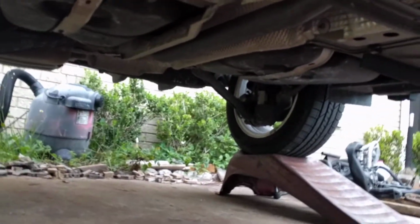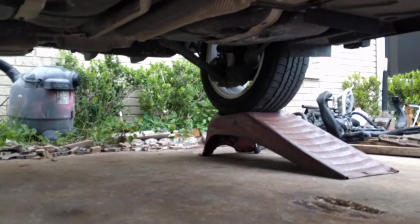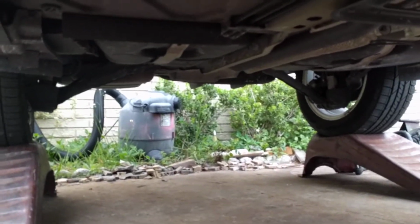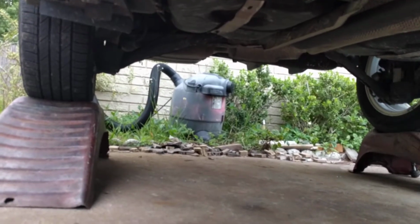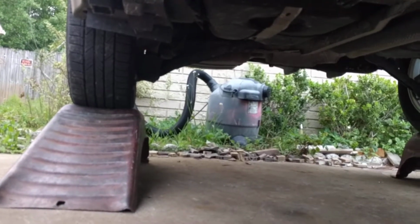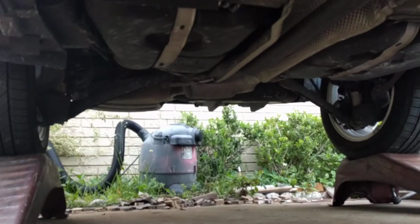There's our rear suspension. It is four-wheel independent. The rear suspension design is taken from the BMW E46, as is the front suspension design, where a lot of the engineering is. The actual parts, I don't think they interchange too many parts. This car does have the rear spare tire, because it's not supercharged. If it was supercharged, it would have a tire inflation kit, because the battery goes in the back and it takes up the space that the spare tire would take. And notice, interestingly, the spare tire is below the floor, not above it.